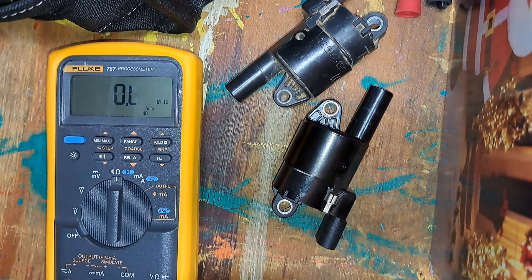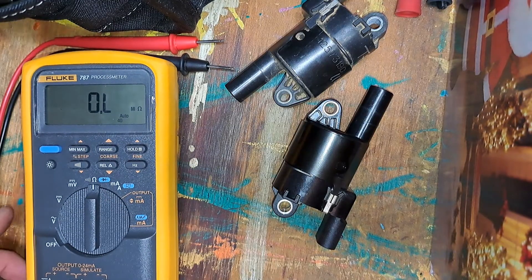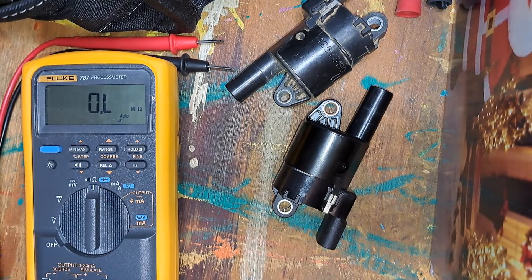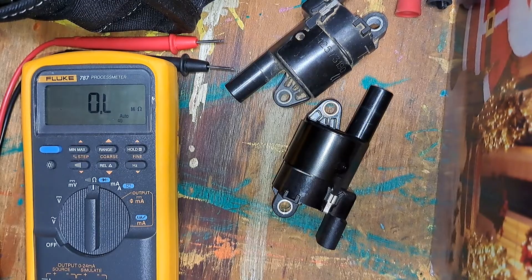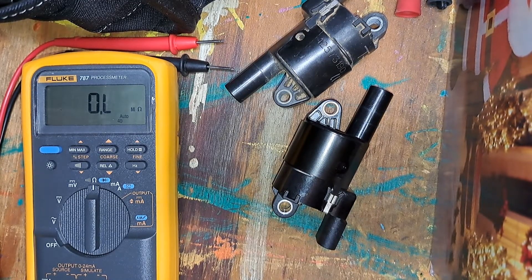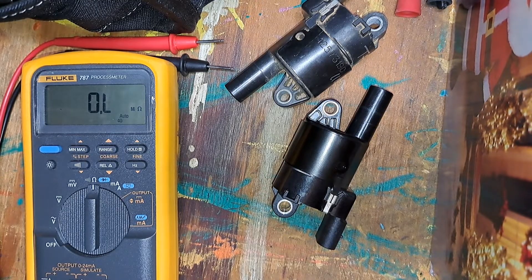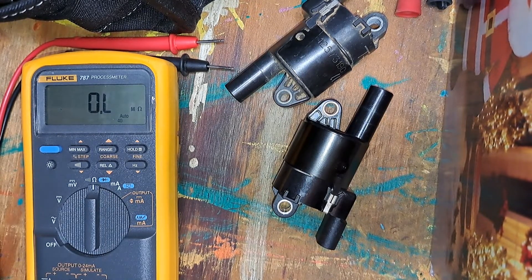Definitely not what you saw on the bad one. Like I said, this is about the fourth time this has happened. I don't know why it's happening; all I know is it's an easy fix. I swap out the plug and the coil every time. The symptoms I get are rough idling at a stoplight in traffic — I can feel the engine missing — and I always get a check engine light. No problems accelerating or on the highway, but definitely when it's idling I can tell the difference, it's not smooth.